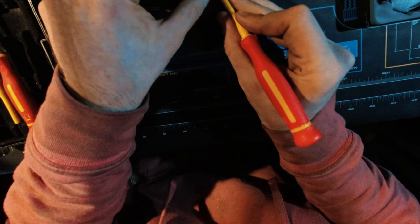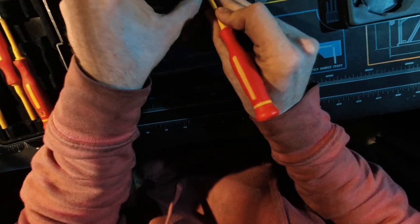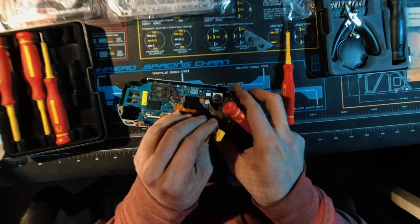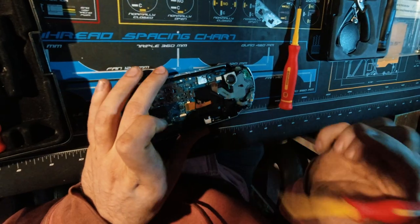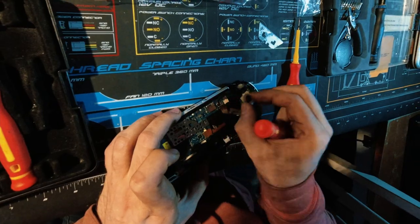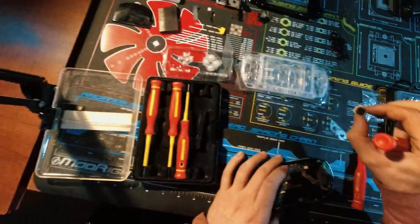The DC jack just goes up. You can push it through from the back in here — just get a little twist and it's out. You're going to move that little tab over towards the left and the speaker pops up. Then we can just pull it over to the left and it comes right out, with the contacts on the bottom.